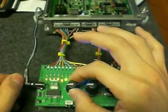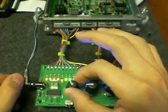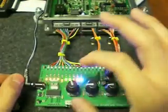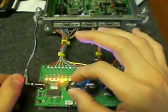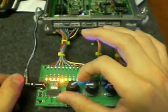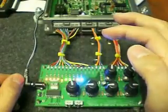We can start cranking this up and we'll see that the firing order starts becoming not really noticeable by the human eye. Now that we've got all the other knobs set, all we really have to do to check the VTEC is just turn the RPMs up. The bright orange light that just turned on is the VTEC light. If we want to make sure VTEC's going to go back off, we just lower the RPMs — no big deal.